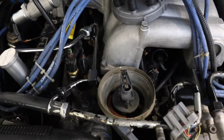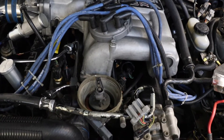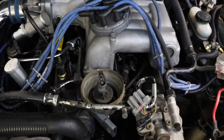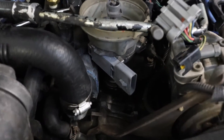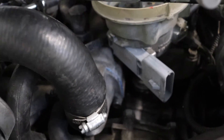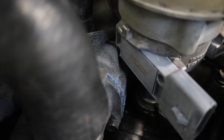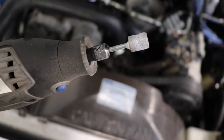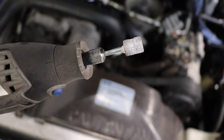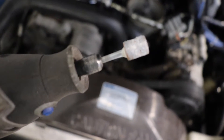Let's go ahead and put this back together. The adjustment bolt down there — you want to tighten it enough so you can still move the distributor, but not so loose that engine vibration causes it to move. I always found the connector on the distributor tends to rub right around the thermostat area, so I modified that area with a Dremel — basically a Dremel with a stone piece on the end, just filed down that corner. It can now pivot easier without interfering with the screw being able to hold the sensor on. Let's clean up the mess and get this thing put back together.